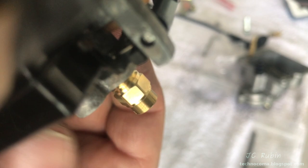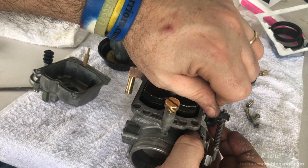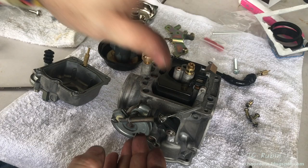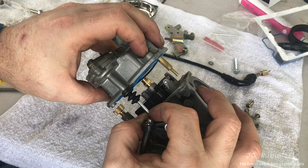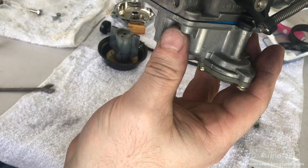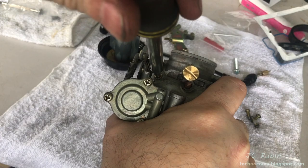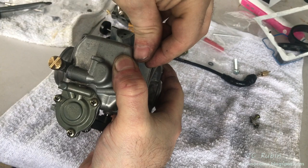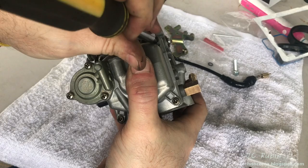The linkage for the accelerator pump is now inserted through the plastic hole. A replacement gasket for the float bowl was provided in the rebuild kit, so putting that on now. Bringing the cover straight on — the first piece to align is the accelerator pump linkage, followed by the accelerator pump nozzle. Turning it over and ensuring the gasket has stayed within the tracks — in this example the gasket had fallen slightly out, so push that back in. With the gasket in the track, everything is sandwiched together; holding the bowl cover shut, the screws are reinserted. It's important not to release the cover — if it comes loose, the gasket will need to be rechecked.